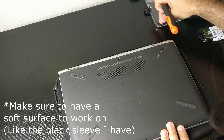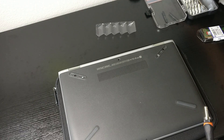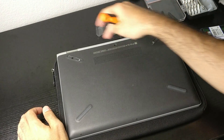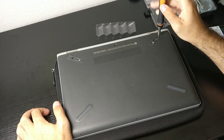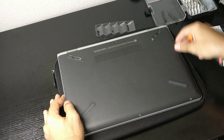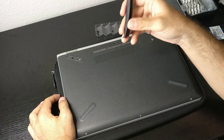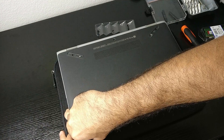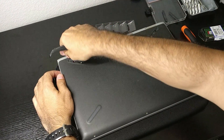We leave this to the side, and now we're going to put the screws here. You have to take six screws in total — three on the top and three on the bottom. After you've taken all the screws out, you need to grab something made out of plastic to be able to pull the cover away. It has to be made out of plastic because otherwise you may damage the plastic cover.